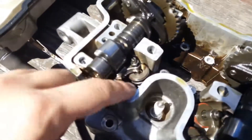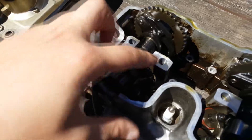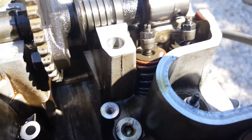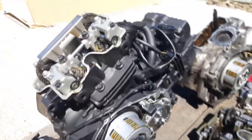The Spada does have twin springs in each valve — dual springs — while the VTR-250 only has one; it doesn't have dual. The Spada has two, and the VTR-250 only has one because the Spada does rev out to 14,000 RPM while the VTR-250 is around 11,500 RPM.